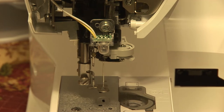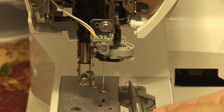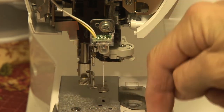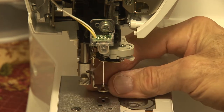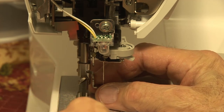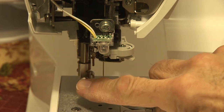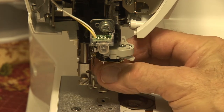So, first thing I did was I come up. I'm upstairs. I took my screwdriver and I loosened the screw that holds the presser foot on the presser foot shaft. And with the screw loose, of course, you could angle this out of the way so it's out of alignment. I wouldn't call it far-fetched, but I think the lady would have looked at the screw, because with sewing machines, usually you take the screw off to change the presser feet. So that's a common thing. It's as common, I would say, as replacing a needle. Right?